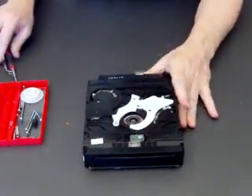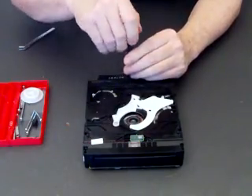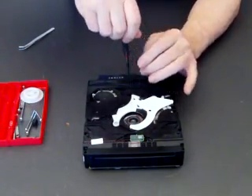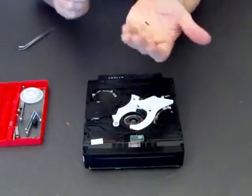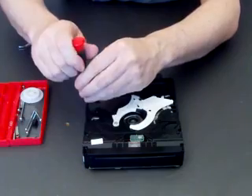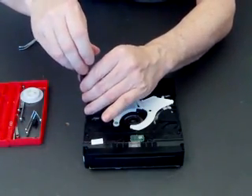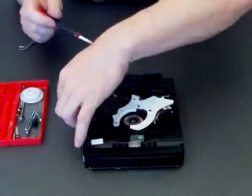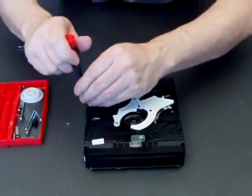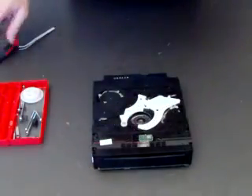So what we'll do is open up the machine. To open your machine you use five of the same screws that your logic board is held together with — just five of these tiny little black screws. Four on the side and one at the back where the casing slopes away, the opposite end from where you put the disc in. Okay, so that's the screws removed.